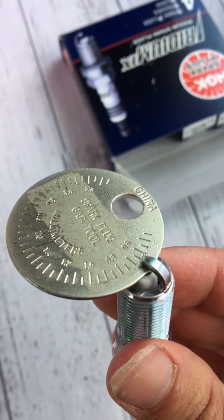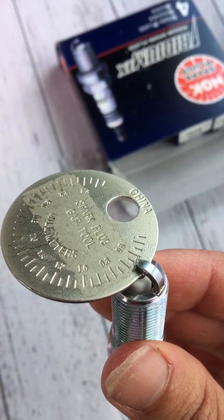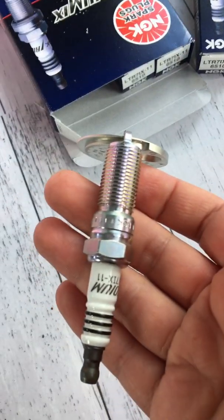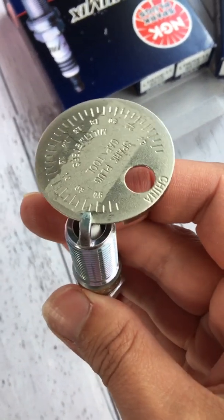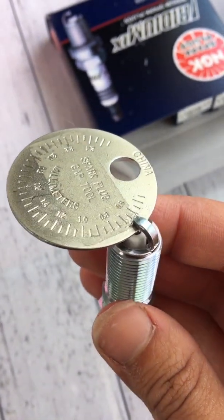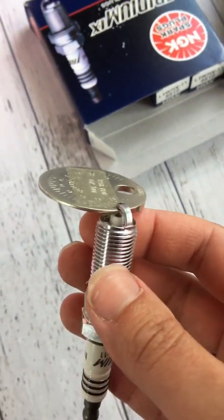I'm back and you can see we're sitting a lot better now. The spark plug was near one millimeter straight out of the box; we are now sitting just under seven - around 0.66 to 0.67 - which is a way better place for my vehicle. It depends highly on your modifications where you need to be with your gap. I'll pop some information in the description, and that is a successful gap. I'll continue to do the rest of the box - thanks for watching.